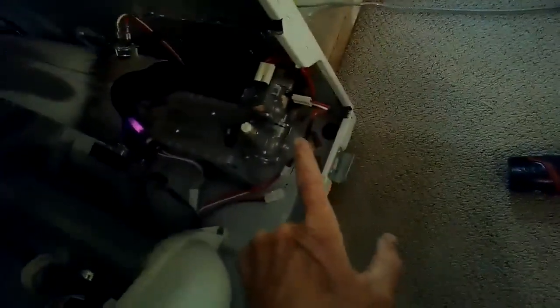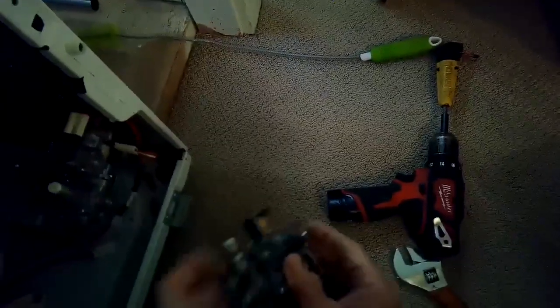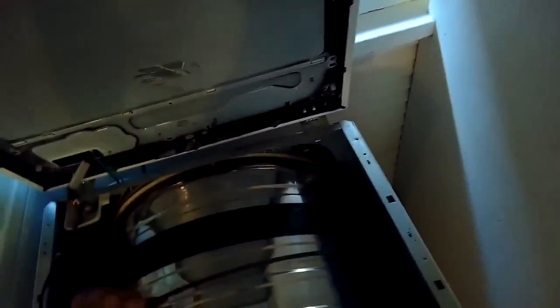In this dryer, this one was actually working but this coil developed a break — it's just copper wire that goes around and around, but it got hot at one point and that copper wire broke, and that's why it wasn't letting in gas. The new gas valve did the trick. We're going to put it back together — lift up, got it unplugged, lift the tumbler back in so it's on the rear wheels and the rear bearing, get the belt back where it was, reach in underneath and pull the idler wheel, get the belt underneath the motor pulley. I hope this video has been helpful and that you got your dryer heating again. Thanks so much for watching — please subscribe, please like the video. Thanks, bye bye.